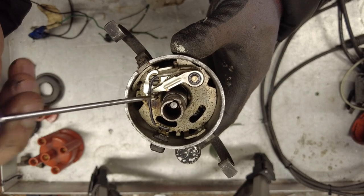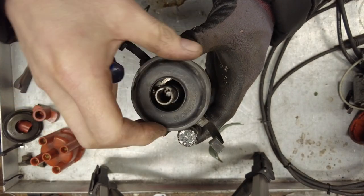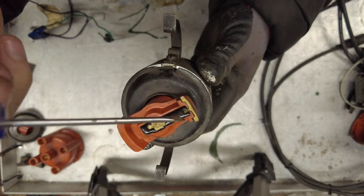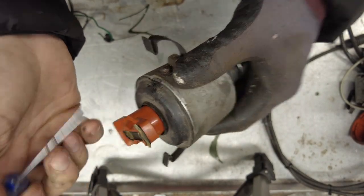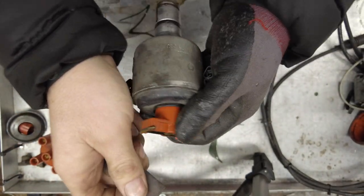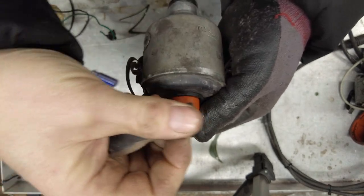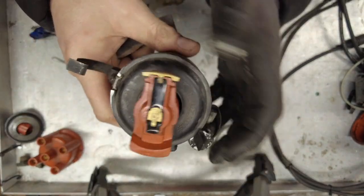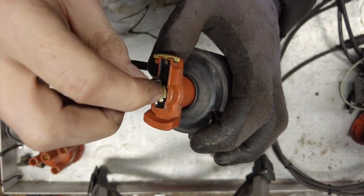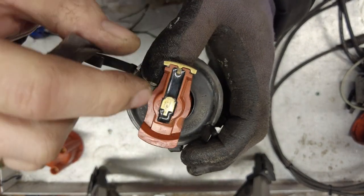So we've done our points breaker, we've done our contact surface. If it's got one — and it should have one — your felt pad is going to get a bit of oil in there, then put it all back together again. Now the next one's a little bit more obvious: here's the end of your rotor. Over time these get a buildup on them — like this one, it's got a buildup on it. Again, just a bit of emery paper, give it a clean, don't go too wild. All you want is for it to be nice and shiny again — get any carbon off, and also make sure you've got a good clean surface on the top for the carbon electrode. A little clean, nice and shiny, and make sure it's not too heavily worn.